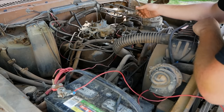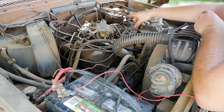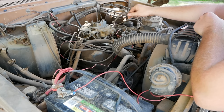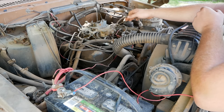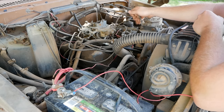And as you can see, we have great spark. And what you just heard was the engine was kind of rolling over soft, and then it went, and you could hear the starter working harder. If I had a guess, that was oil pressure actually building in the motor. So that's not always a cause for concern, but if stuff starts cranking harder, sometimes you might want to stop and roll it over with a ratchet again.